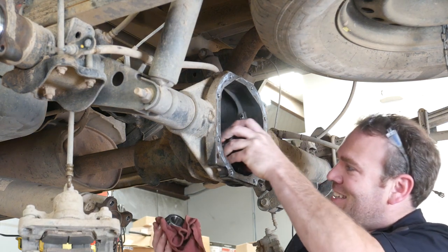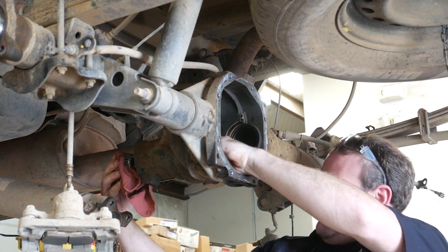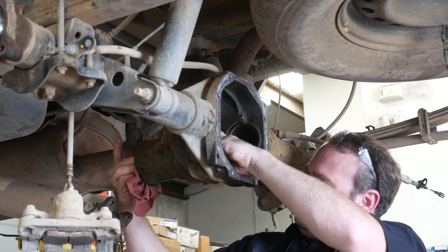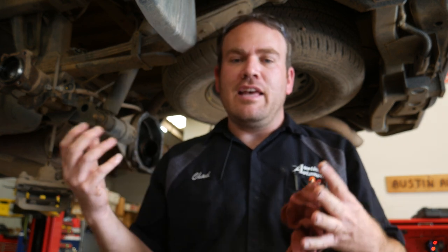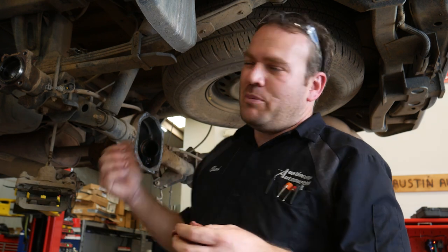Okay, so the bearing is hot. The bearing didn't go quite as far as I wanted that time — I was trying to stay in frame for the camera and had a slight delay. So I may knock it back out and redo it. But it did go on far enough that I could get the pinion flange on and get the nut started without too much struggle. It'll be easy to knock the pinion back out, heat it up a little more, and slap it together. I got it to about 200 degrees, but by the time I grabbed it with the rag — I need to get a leather glove to be a little faster. As soon as it touches that pinion, it cools down very quickly and shrinks onto it.